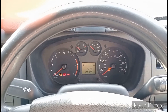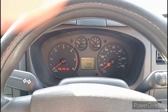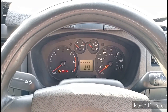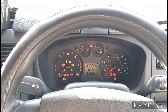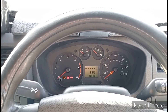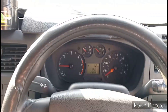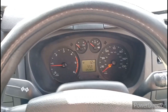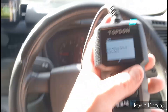This will get you out of a bit of bother if you've got an MOT in the morning and your engine management light is on because of the EGR valve — it will fail with that light on. So buy yourself a machine, £18 or £15, whatever they are on eBay or Amazon, get it plugged in, get that light off ready for your MOT. Just to let you know — with EGR valves, once you take the light off, it doesn't stay off for too long. But the engine management light is off now.